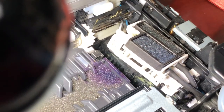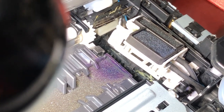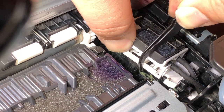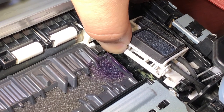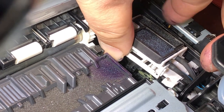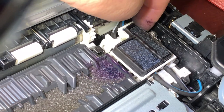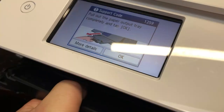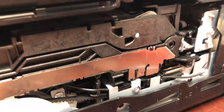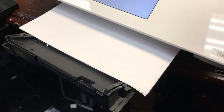Now back to this printer — this is exactly like how we started, it went sideways. However, this time when you lift it up, you'll find it's harder to lift because the forklift has caught the lever, and that's a good thing. Make sure you're pulling from underneath — don't just pull on the white part, pull on the black part. Also don't pull too hard or your forklift is going to break. Lift and push forward. You should hear a click and it falls right in. If you see it can go up and down, that's a good sign — that's because the lever is inside the forklift. Okay, that solved the worst scenario. We've got one more printer to fix today.